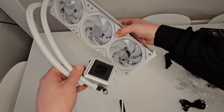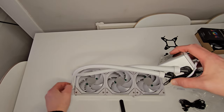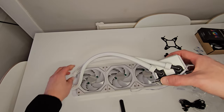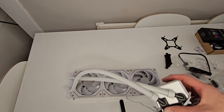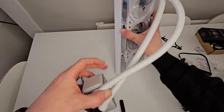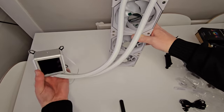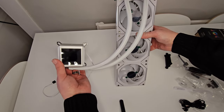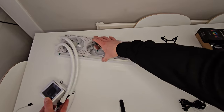At the top here we have 45-degree rotary fittings — another nice touch by Lian Li — which should allow you to swivel the hoses into position to suit your case and keep everything clean and tidy. I'm hoping to position the radiator on the side of my case, with the pump positioned with the hoses to the bottom, which is the preference by Lian Li if you look at their documentation.